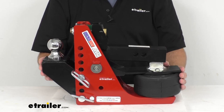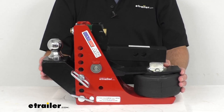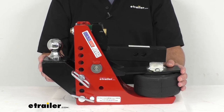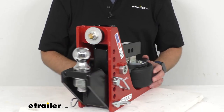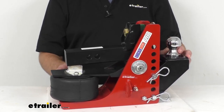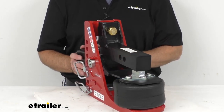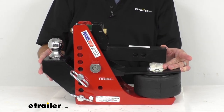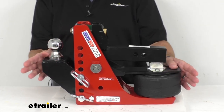This requires a minimum of 7 inches of clearance between the center of the hitch pin hole and the rearmost point of your truck, and 5 inches of clearance below the bottom of your receiver tube. Your receiver opening should be flush with the bumper or protruding from the rear of your vehicle for best fit. This will not fit SUVs, CUVs, or sedans due to limited clearance, and it will not fit a 2-1/2-inch hitch even with a reducer sleeve because trucks with a 2-1/2-inch hitch have deeper frames.